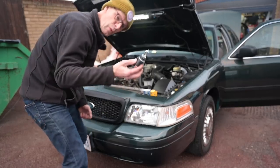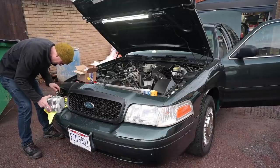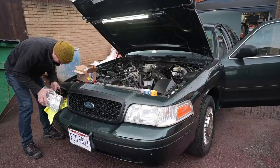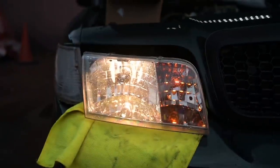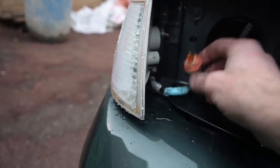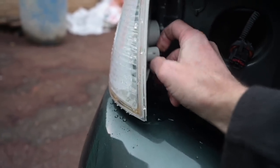Fit the bulb in, the collar goes on afterwards. That now works - it was a dead light previously and it's an awful lot crisper and brighter than before. The side lights are easy to undo once you've got the headlamp out - you go in from behind. There's a second wire here which I don't think goes anywhere, but there is an opening for another light bulb in the bottom, which I think would be for a strobe if the car was in police service.